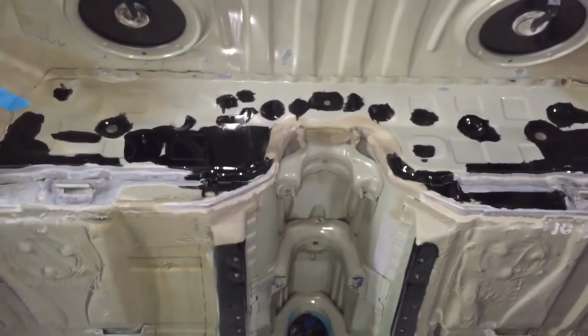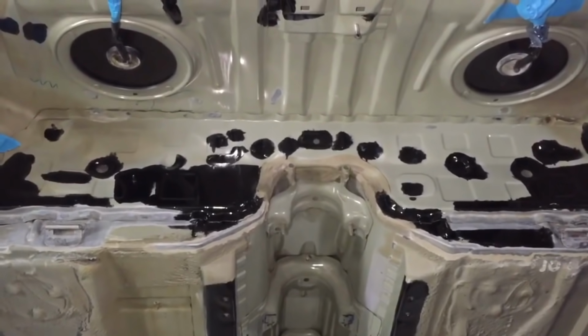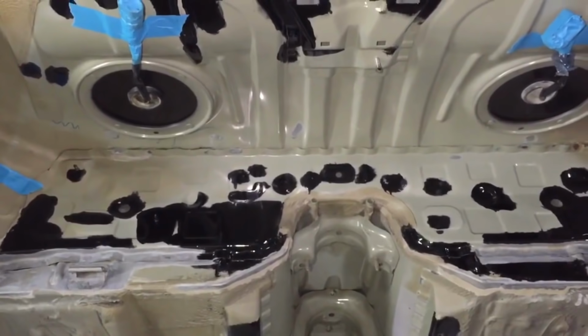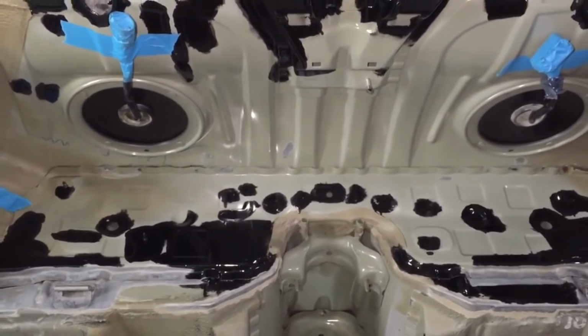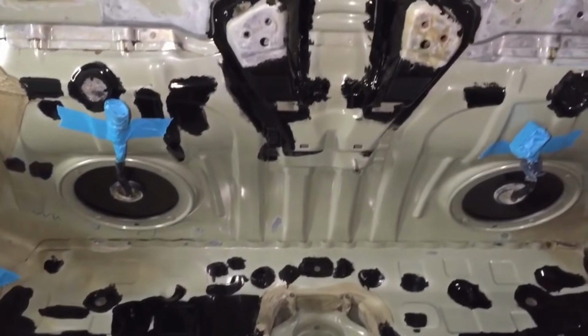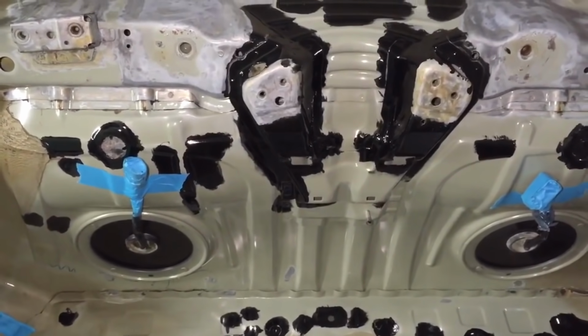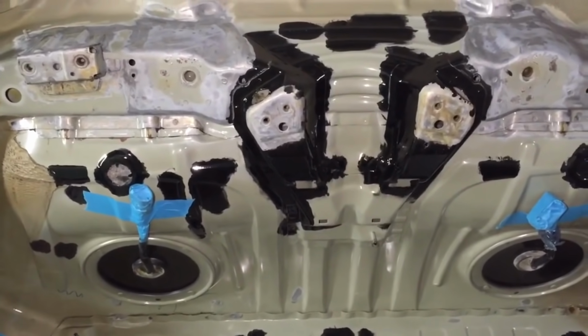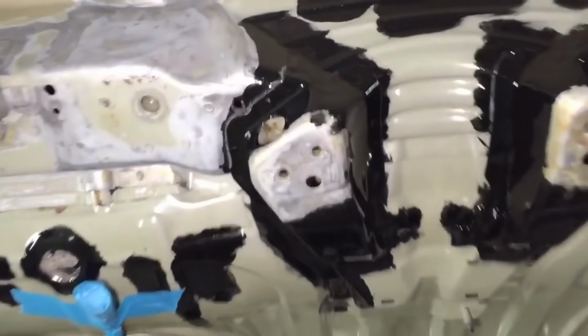And if you did do it over several days and left some of the bare metal at the start of the process, when you went back to it, you'd find that it was hazed over with corrosion just in the atmosphere. Just the moisture in the atmosphere would make it corrode, so we do it in stages. So some of this has already been treated with the marine clean, which happens first to get the dirt off, and then some of it, the hazy sort of etched looking areas like here, that's had the treatment.